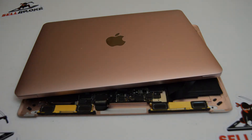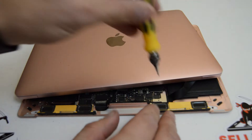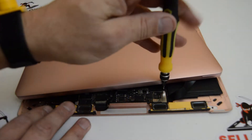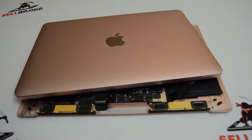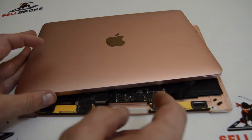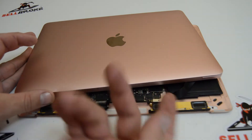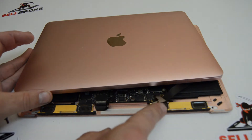Didn't see that at first — switching over to a T5. Actually that is a T5, and a T6. So they used two different fasteners there for the bracket. Just pop that connector up and off and give a little bit more slack on that ribbon.